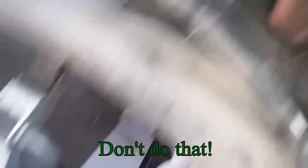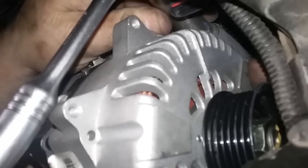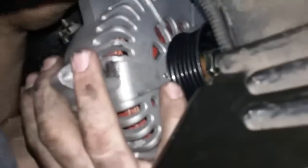If you do this right, you'll get your arm covered in transmission fluid. Then we can loosen it up just a little bit. Ow! Be sure to hit your head on the jack stand because that's the best feeling ever. Trying to get this up on there. And it should be able to loosen up a little bit better now and hopefully come out. After you break it loose enough, hold the alternator, and then you should be able to loosen it with your fingers enough to get the stud out. And then throw it away into the garbage. And then you can take these bottom bolts out.